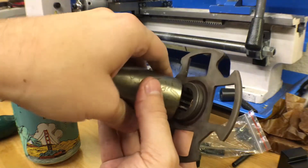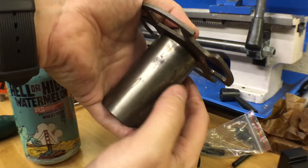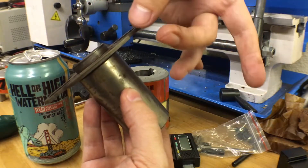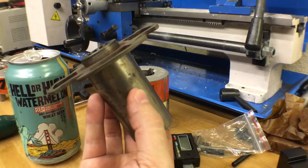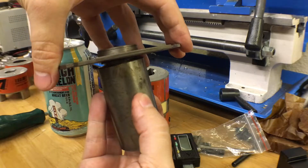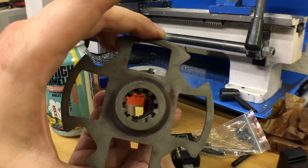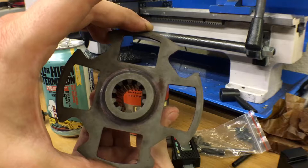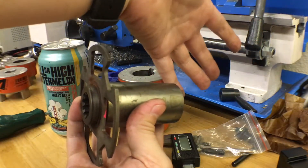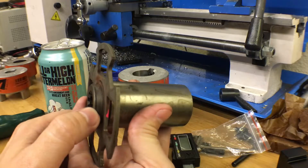One way to do this is to actually weld it up — just machine it so it lays flat, run a bead of weld around here, get all the other measurements right, get the distance between the transmission shaft and the motor shaft correct, and you're done. The only problem is I'm not a trained machinist. If it ends up tilted or a hair off to one side, it'll wobble as I'm driving and eventually tear up either the transmission side or the electric motor side — and in our case it's an expensive electric motor. You don't want to be tearing up the bearings.